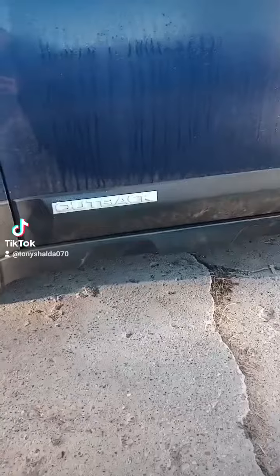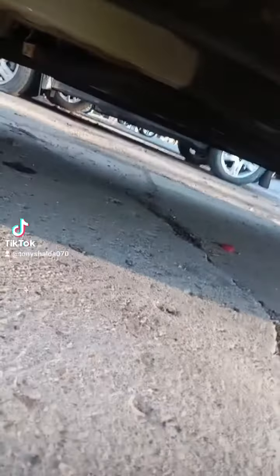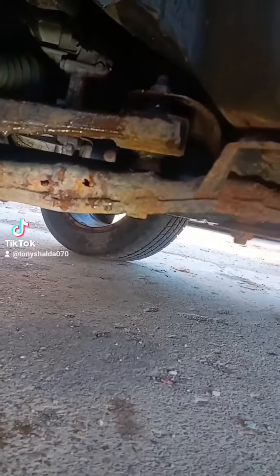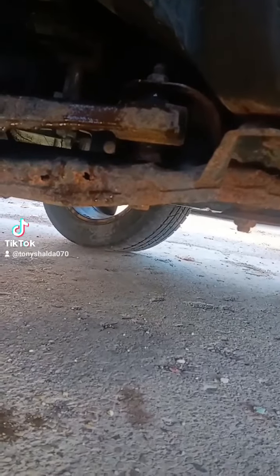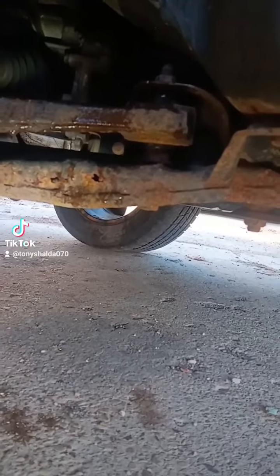You can lift the plastic on this rocker panel and there's no rust underneath. When you get on your hands and knees and look under the car, you don't see any real rust issues — unless you happen to lock eyes with that one part right there. That's probably the most important part of the whole car: the suspension cradle. The engine's attached to it, the suspension's attached to it, your wheels are attached to it. If you miss this problem, it could actually be fatal.